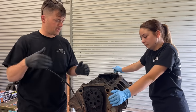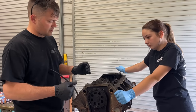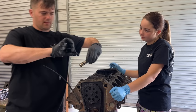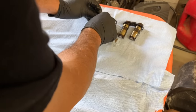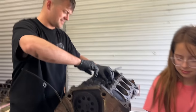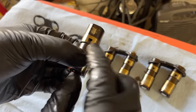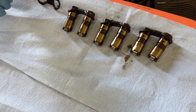If you watched the last video in the RV, we've already pulled the cylinder heads and kind of gave it an assessment that it needed bearings and stuff. We're going to go ahead and pull the lifters out of here and keep all this stuff in order — the direction it was sitting and everything — because we're reusing these and we don't want to get them all mixed up. These lifters are directional even though they're roller lifters. See that little groove there? That goes to the top when you put them in.